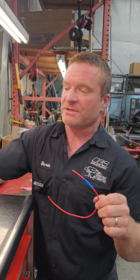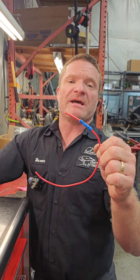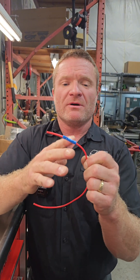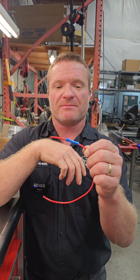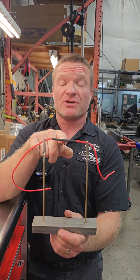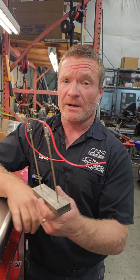And the classic butt connector. Butt connectors - here's a big one so you can understand what it is. These guys will get you out of a pinch. You should carry something like this in your truck if you're going off-roading or camping. They work, but they're not permanent. When we go to crimp these guys, it's hard to tell if I got the wire far enough in, you crimp it, it kind of smashes it, it doesn't make it permanent. And a lot of times they come apart, and you can't seal them from moisture. How we roll is we use a butt connector that we can solder, and then we heat shrink it so that it seals it all up. We're going to show you guys how we do that.